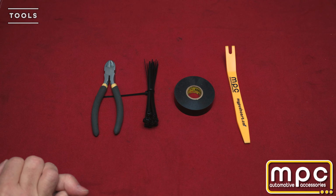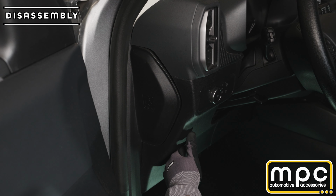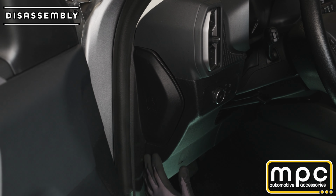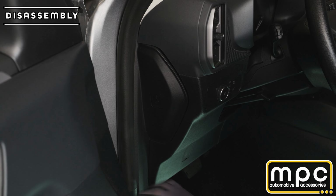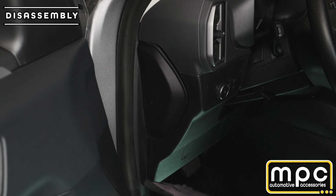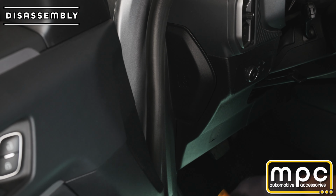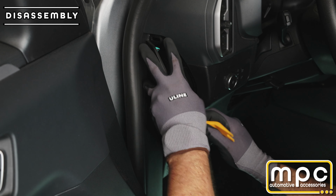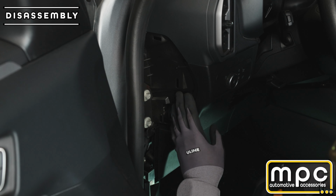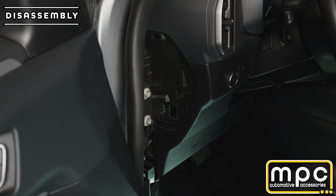Let's get started. To start the install, we're going to have to remove this lower dash panel. To gain access to removing this panel, we're going to pop off this small panel right here. You'll pull your molding loose, then take your pry tool and pry it right in. That will pop out, and that accesses this portion here. Now we're going to be able to pull off this lower dash panel.